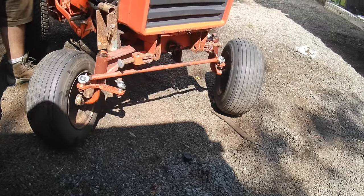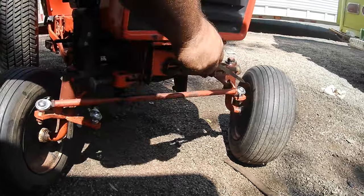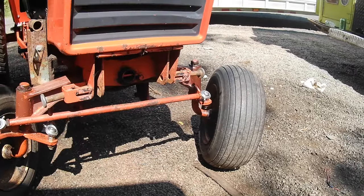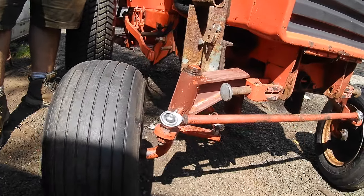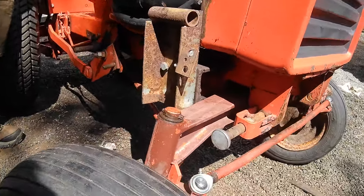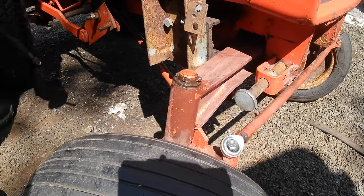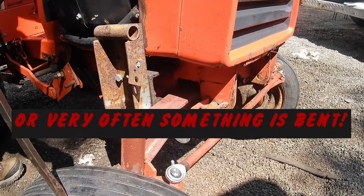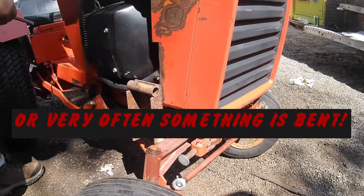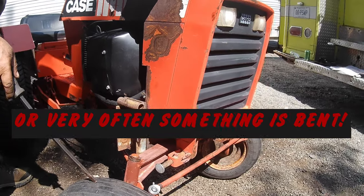That's a turn to the right. And again, your stop is hitting. These tractors tend to turn a little better to the right, but not noticeably a huge difference if they're set up right. So the major cause tends to be they're off one tooth on the steering gear that we're talking about. If that's the case, you have to drop the gear and move it over a tooth, depending on which direction they're turning more to.